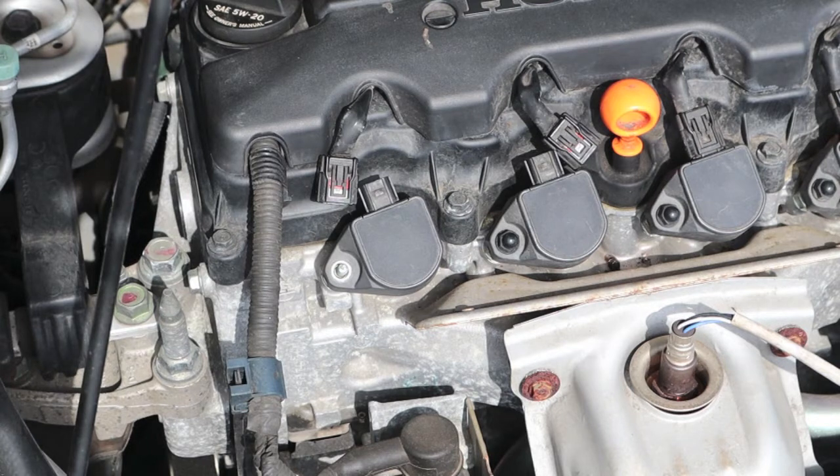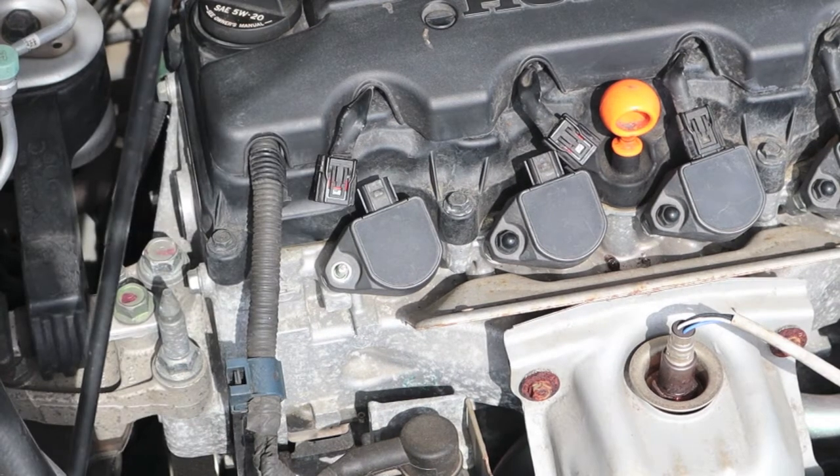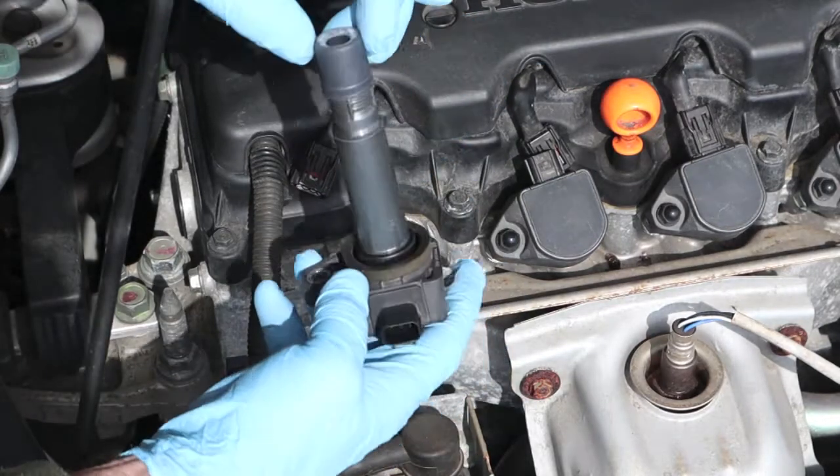This is the 10 millimeter. I'm just going to show the one — you've got four of them. This is the 1.8 liter. I've seen some of the comments on other spark plug change videos asking about the back four on the Honda Civics. This is the 2008, 8th generation. You don't have eight plugs on these four cylinders — you do on the hybrid. This 1.8 liter Civic has four in the front, very easy to get to and change out. When you get that 10 millimeter nut off, it's just a firm pull to break it loose.